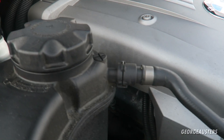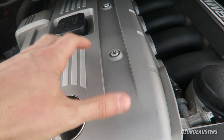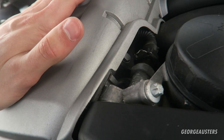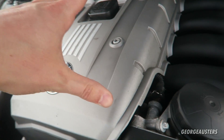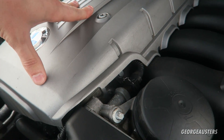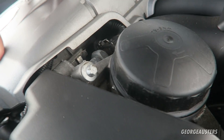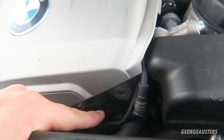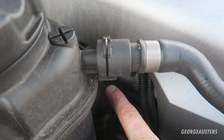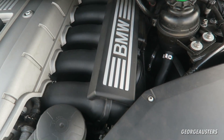The next item that will fail after 100,000 miles is the valve cover gasket. It is located underneath this plastic cover — yes, this is just a plastic cover. On this particular engine the valve cover is magnesium; on later N52 engines they changed it to a plastic valve cover which is actually a better design. It is common for the valve cover gaskets to leak. You'll know if it's leaking if you have engine oil at the front of the engine, at the side, or leaking onto the exhaust itself — leading to bad smells in the cabin.